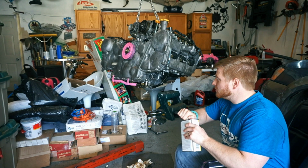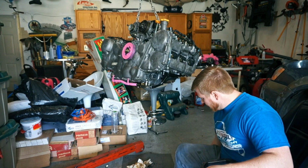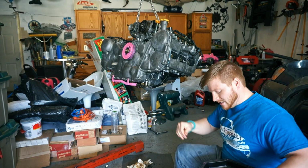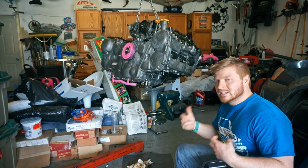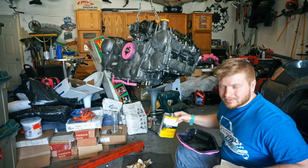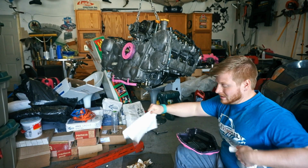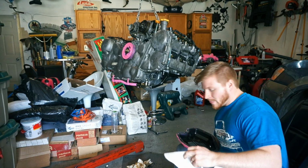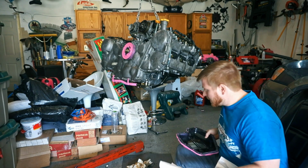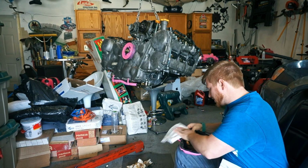Alright, so things are continuing to move forward throughout today. When I had the engine up, getting everything put on it, I did notice a couple of spots that looked like they might be seeping a little bit of oil. Not that there's a major oil leak on the oil pan, but I figure it's off, and it's really easy to get to right now. So I went ahead and pulled it off and cleaned off all the RTV. And I even painted it to match.